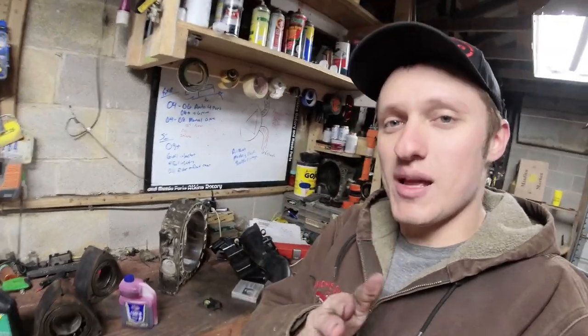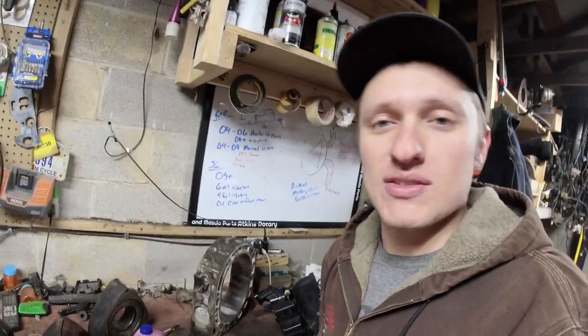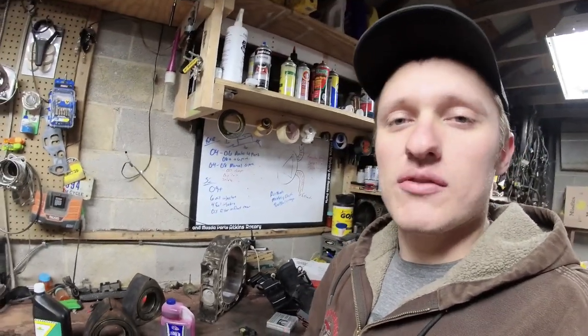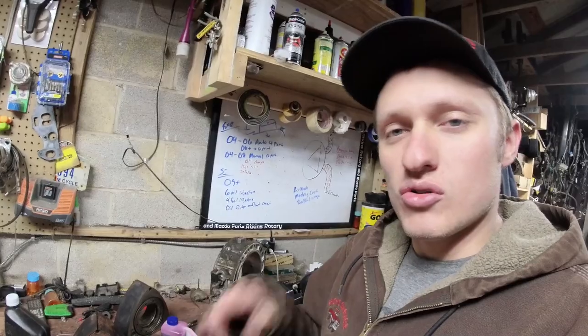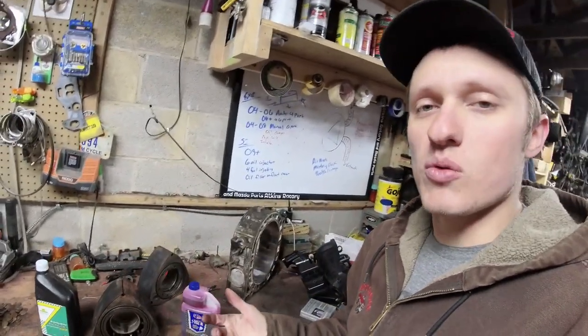So there's definitely a balance there, but here's what I'll tell you. And the reason I say you don't need to premix, 100%. If you're just daily driving your car on the street, run good oil, rev it out, get that carbon out of the engine. You're not going to have an excessive amount of wear on your engine.